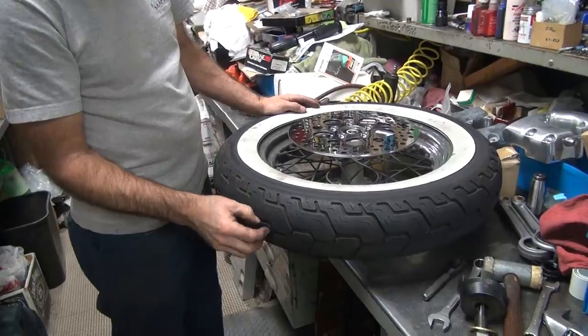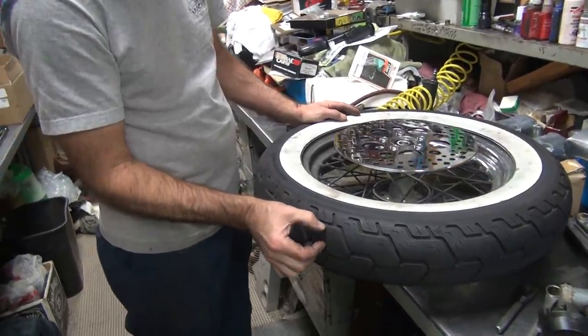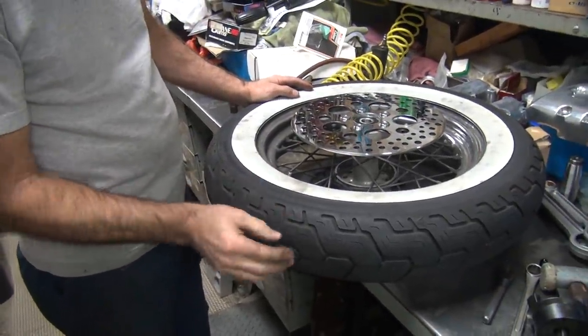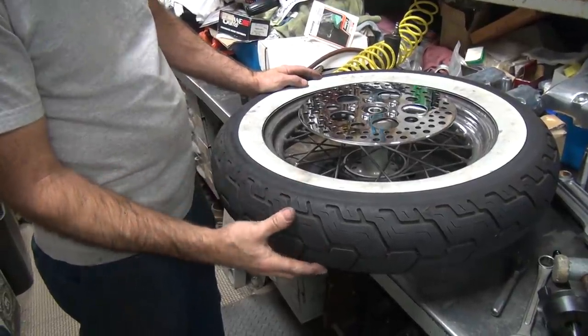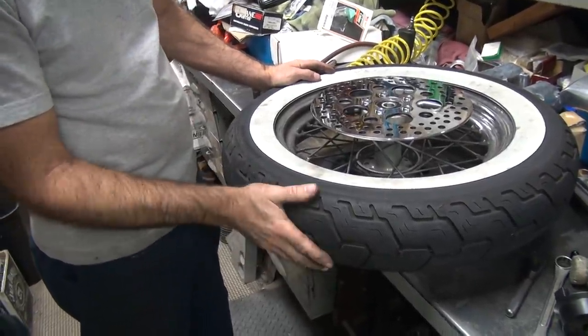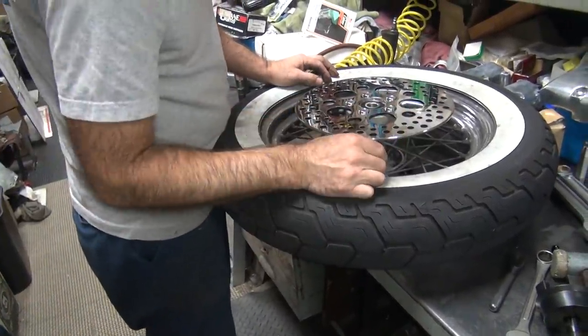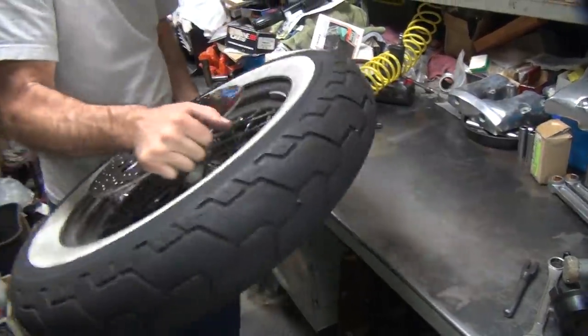If the tire doesn't give a little bit in the corner to let the bead get more in the ground, you're on a thinner area and you can fall down. You lose traction. So there's a point where you get maximum traction for the conditions you're riding in. And you figure that out by experimenting. Nothing written down means anything. I don't care what you put down.